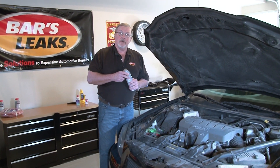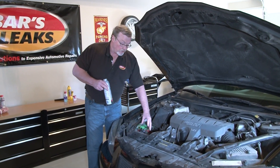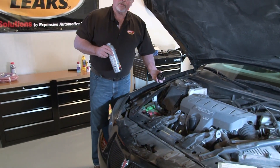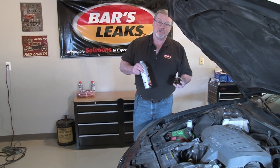After the 15 minutes, shut the vehicle down and let it completely cool off. Again, remove the radiator cap once it's cool — we don't ever want you to open up a cooling system when the engine is hot.